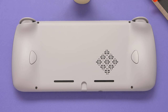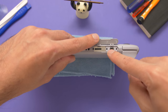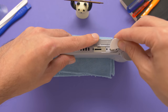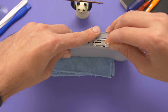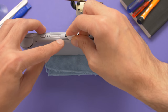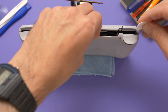Now let's do a teardown on the Odin Pro. This is a retail device, so it actually has screws on the back that we need to remove. For this, I'm going to use my normal Phillips head screwdriver. To remove the back, I'm going to use the exact same strategy from before — open the SD card cover and insert a guitar pick into the gap to slowly pry open the two clips, making sure not to damage them in the process.